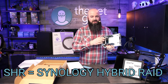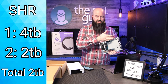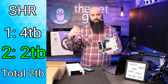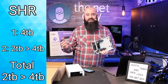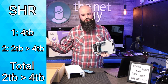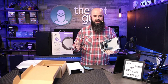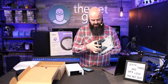This also has Synology Hybrid RAID. What's cool about that is — let's say you've got a 4-terabyte and a 2-terabyte drive, that's all you have. You put them in here and it's going to create a 2-terabyte RAID 1, meaning the drives back each other up. But if you get another 4-terabyte drive, you can swap out the smaller drive and double your storage. Versus regular RAID where you have to rebuild everything and can't resize easily — that's the Synology Hybrid RAID advantage.